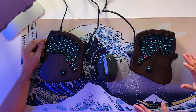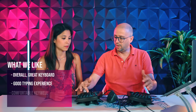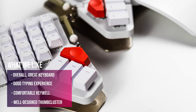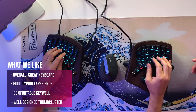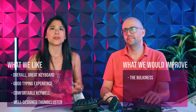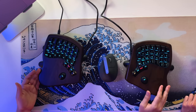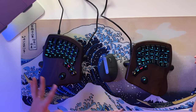So Mick, what's your final word on this keyboard? It's a good keyboard. If the Defy didn't exist, I would get this one over the Moonlander or the Kinesis Advantage, 100%. The keyboard is really comfortable — the thumb cluster, the curve compared to the Moonlander's square thumb cluster that is difficult to reach, this thumb cluster is really comfortable. But you have to think about how bulky it is. It's more about what features you appreciate: do you like sculpted keycaps but don't want to go for a concave keywell? Are you tall, or do you use a standing desk and don't mind the bulkiness? Are you okay with a few degrees of tenting? Or are you looking for a unique retro look? Then this is the keyboard for you. We hope this review has given you some valuable insights. For those who have tried the Keyboardio Model 100, let us know in the comments below. We'll see you next time.